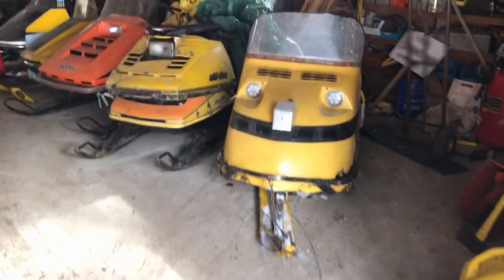Well, folks, we parked the Super Alpine back in, and I'm glad we got it running. It's a little wrap-up of what happened. When I thought that it didn't have enough oil and I added more in, I actually added probably way too much in. I have a hunch I'm at like 25 to 1 or more, and started fouling plugs. I was playing with the jet, seeing if it could run, but it wasn't running all that great. So next step's gonna be to maybe dilute the gas a bit, check the plugs, probably foul the plugs. I want to open up the carb, clean it out, just give it the tune-up that it should have gotten today.